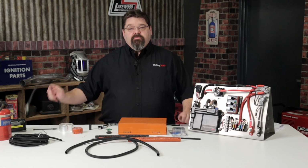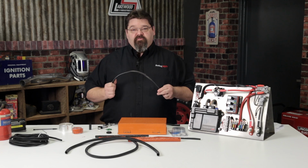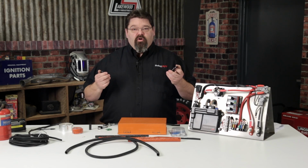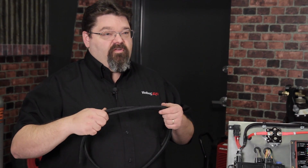The engine and chassis must be properly grounded. Using a vehicle chassis as your primary ground, as we've previously discussed, is not sufficient. You want to make sure that you use proper grommets anytime that you're passing the wire through bulkheads, as well as use a high-quality loom to protect the wires from any abrasions.